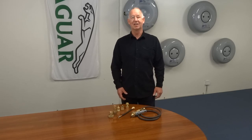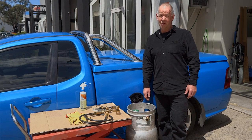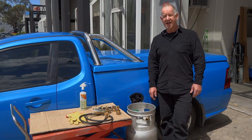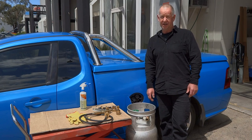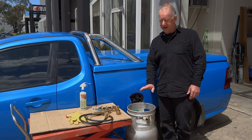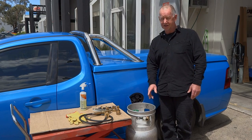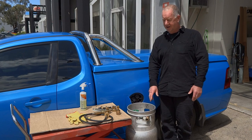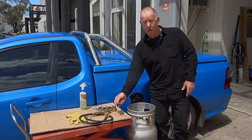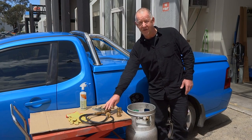Now let's go outside and see how it works. This car's out of gas — it'll start and run but it won't drive, so we're going to decant some gas into it to get it going again. When decanting LPG, we need to decant liquid LPG. Today we're going to use a forklift bottle. A forklift bottle is a liquid withdrawal bottle, so whether it's standing up like this or lying on its side, it's decanting liquid straight out of the service valve — no need to invert it or turn it upside down. By using the forklift bottle we're fully WorkSafe compliant. We're also going to use our forklift adapter and automotive adapter.